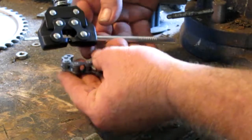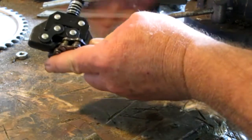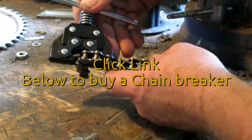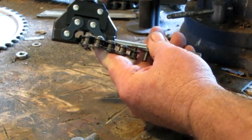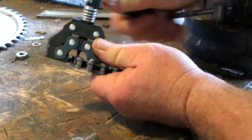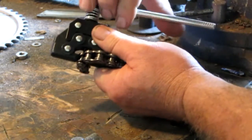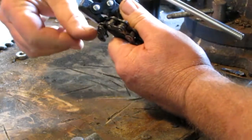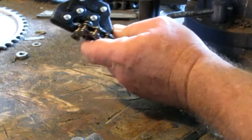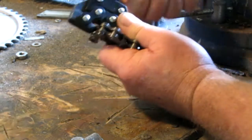You spread the jaws of the tool, get a grip where the pin link mates to the roller link. The pin link has the face on it and the roller link sits inside underneath the pin links. We're going to force out the first pin that connects to the roller link on the section of chain we're keeping — it gets hard, then it just pops through the top plate. Loosen it up, spread the jaws, clip on it, crank down, and it pops loose.